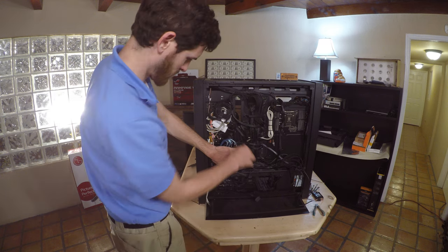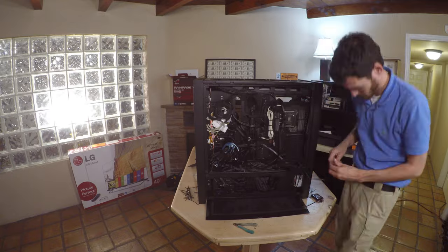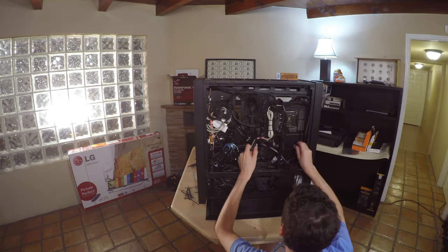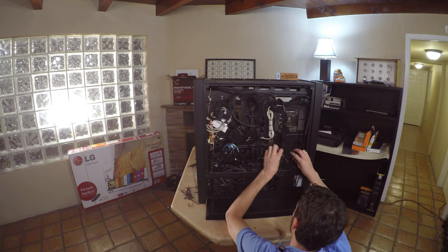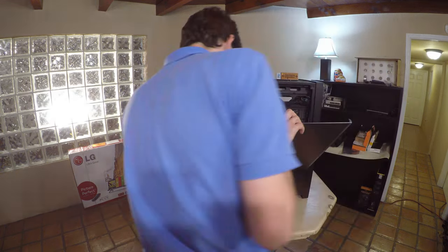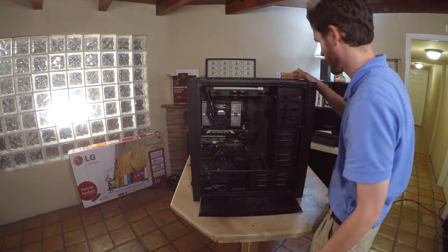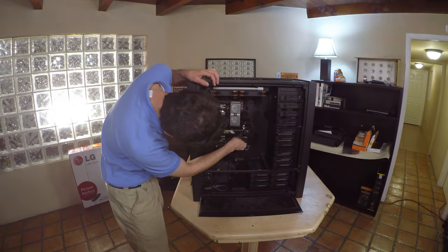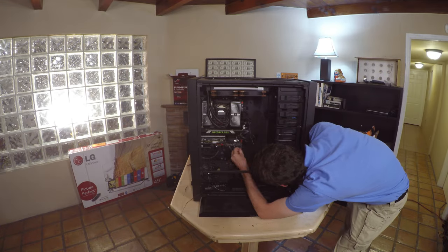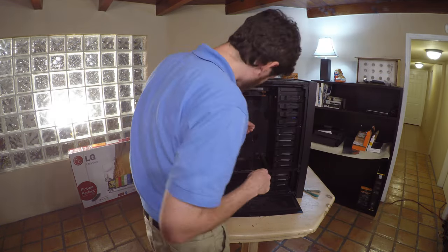As you continue to dress in the cabling, make sure everything is secured, but also functional. Do not have any cabling bent past 90 degrees, nor do you want it sticking out so the case cannot close. Now, from the front side of the case, secure any remaining sensors or cabling that was left behind. This is the final stage, so neatness counts.